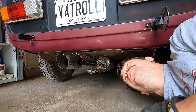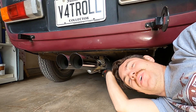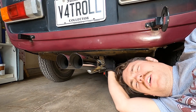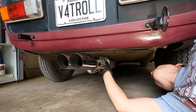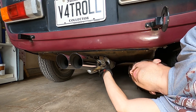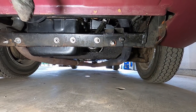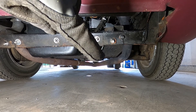One thing I do have a lot of trouble with is the exhaust. I welded this thing up and unfortunately had my angles wrong, so I welded the muffler on at a bad angle — bad enough that the muffler rattles against the trunk floor and actually touches it right now. It'll rattle if I let the clutch out wrong. So I've got to pull the whole exhaust off, cut it off, put a V-band in, and be able to adjust that angle next time. I also got a different hanger setup. I did already put a V-band on the passenger side — it didn't quite do what I wanted, so I think I need to add another V-band on the driver's side.